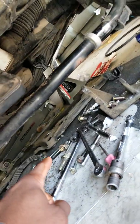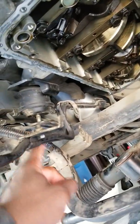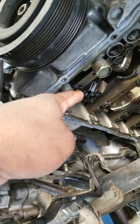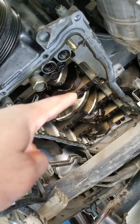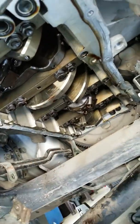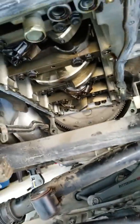Pretty much what I did was take off the crossmember. I took off the engine mount bolts and just jacked it up from the transmission to get it high enough. When doing that, you have to remove the oil strainer bolts in order to get the pan off. It's actually the oil strainer — not the pump — and it's right here. You have to remove its two bolts: two 12mm and a 10mm here. You have to loosen it up while the pan is hanging, or you'll never get it over that frame.